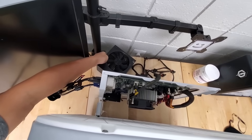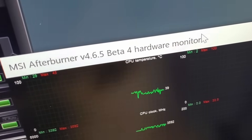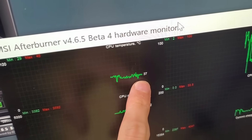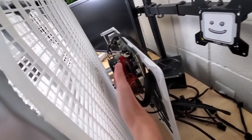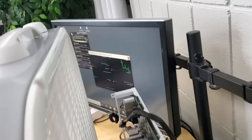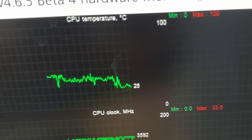Let's turn on the PC to see if it actually helps. With the box fan turned off, we can see the normal temperature of the CPU in this system is around 37 to 39 degrees Celsius. And so now if we crank up the fan to its highest setting, anecdotally I do feel tons of cold air being blown onto the motherboard. And if we take a look at the actual graph, you can see that the temperature has already dropped over 10 degrees Celsius.